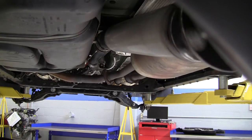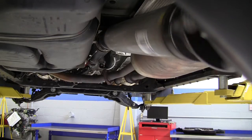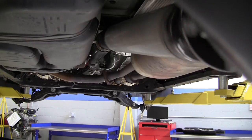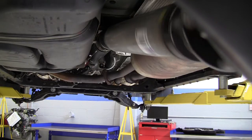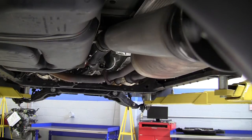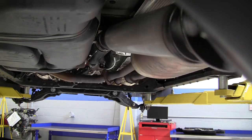This is a demonstration of propeller shaft runout measurement. Since I'm alone doing this video and don't have someone to help me turn the propeller shaft, I've started the engine on this truck, put the transmission in low first gear and the transfer case in low. That way the rear propeller shaft is rotating about one and a half times a second — the slowest speed I can get — but slow enough to hook a dial indicator up and get some runout measurements.